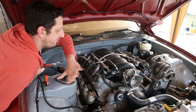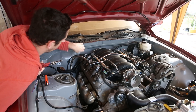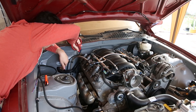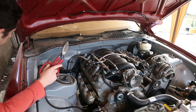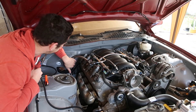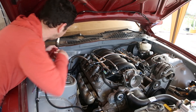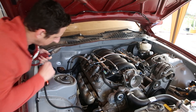I have to unhook everything from the engine that's already hooked up and bring it back through inside the cabin to go back through a hole again, which is unfortunate, but at least I will have it done the correct way and I won't feel like I've half-assed this. It'll be safer because my loom will not be wedged against the firewall and it'll be far enough away from the exhaust to avoid melting wires, which for a safety standpoint and not causing fires is pretty important.